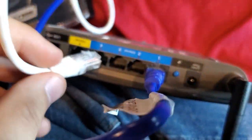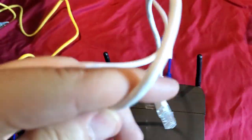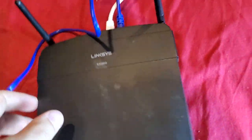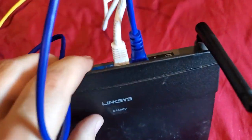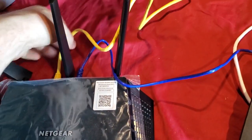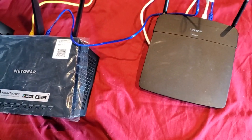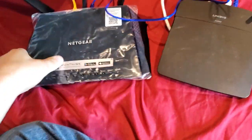I know a lot of people like Wi-Fi, but I would recommend plugging your PlayStation or Xbox into a LAN port on the secondary router if that's where your gaming system is located. Let's pretend this white cable goes to my gaming system — I recommend a wired connection. If you plug your gaming system into a LAN port on the secondary router, and the secondary router is connected LAN port to LAN port to the main router, which has a WAN internet connection, then everything will be able to get on the internet and you won't have any double NAT issues.